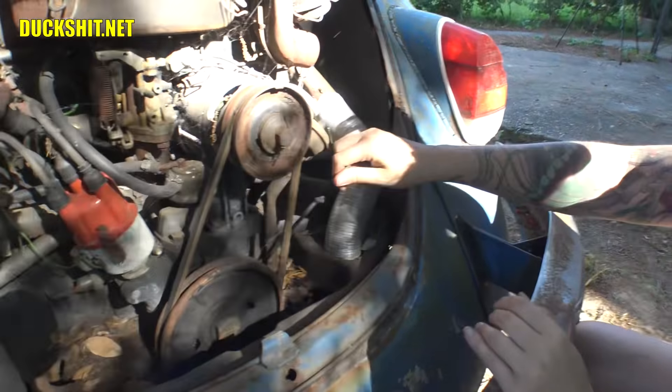Back here is the side where the battery lives, so we need to look underneath the battery. What happens is the battery could leak acid. The acid doesn't actually eat the floor — it eats the paint. And any moisture that gets onto the exposed metal will of course rust it through. So to see a rust hole back here is not a surprise — it's pretty much standard on all Volkswagens. It looks like it's only the battery area back here that's rusted. It looks like it's going to need a quarter pan in the back side. You also want to look along this area — there's the VIN number. Make sure the VIN number matches whatever title or paperwork they give to you. This is the VIN number that's going to count. Don't worry about the VIN numbers on the rest of the body — that's the one that matters. Obviously it has a back seat — we're going to pull that down and look behind that as well.